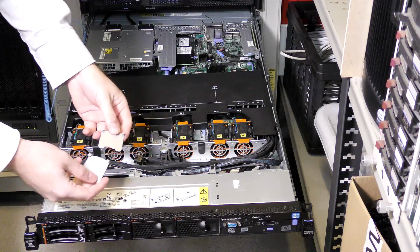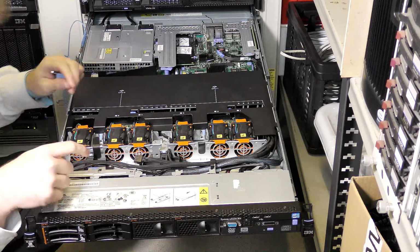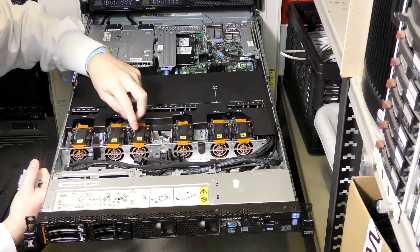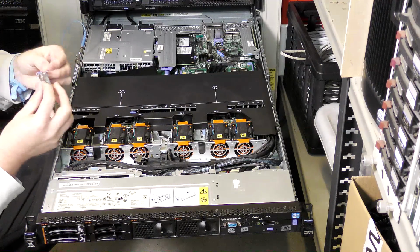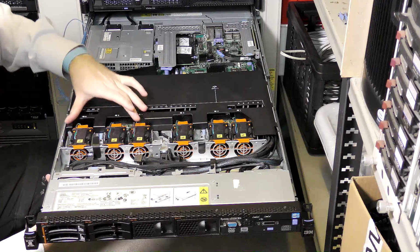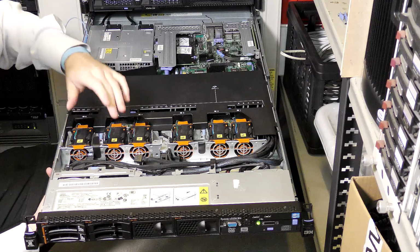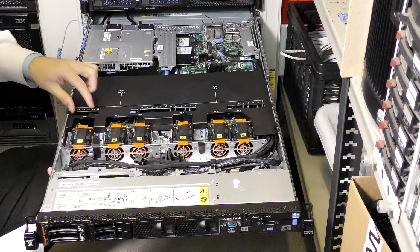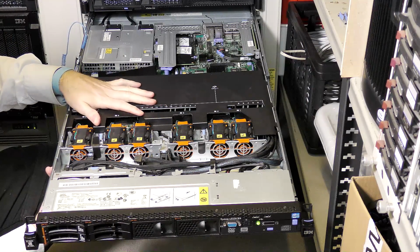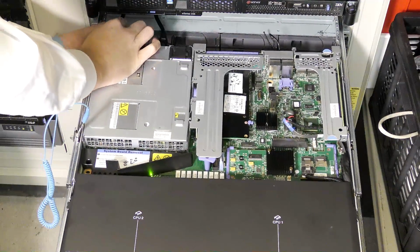We saw in another video that I took out these two metal brackets and put in the CPU instead. To put in an extra CPU, you need the two missing fan blowers. Oh, I think I can actually see it on the label here. It was this one and it was this one. That was the two CPUs that I put in. Okay, so for putting in an extra CPU, you need those two fan blowers installed in the system as well. They're gonna be blowing air this way, and the CPU is right here. So when this CPU is not there, there's just one fan blower to keep this sector cool over here. There's some RAM slots down here, but they're not used. All of this is not used when there is no CPU there. So as you can see, the LEDs are blinking down there, so we have power on the system. I'm gonna remove that.